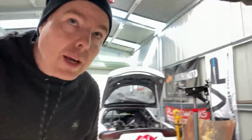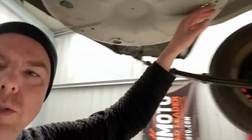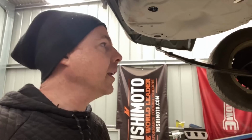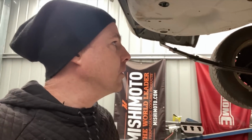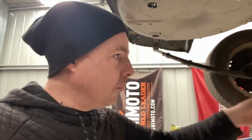And what I'll do in the back end of the car is, this wheel tub is all rusted out, and I've got 2 or 3 Mazda RX style radiators anyway. So I'll just lay one of those flat with a 16-inch thermo fan on it and a Davies Craig water pump, and just pump water back and forth, and it can cool there.